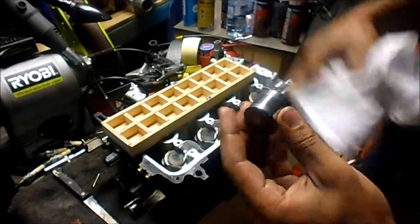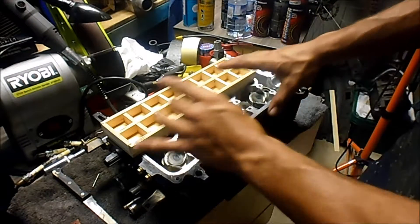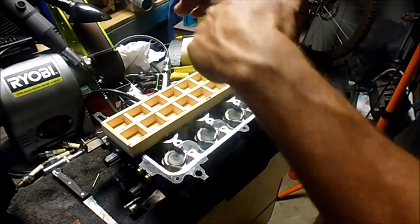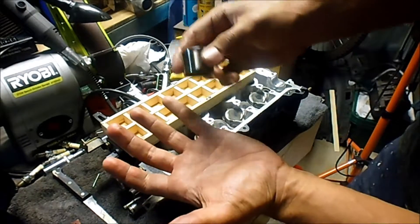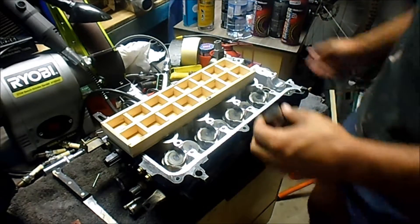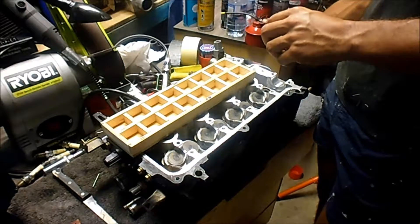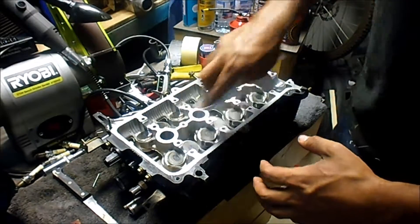Just give them a wipe over, inside and out, if there's anything in them before I put them in. I got the engine and blew out the cylinder where these go inside — the inside surface — just because I didn't want anything scratching that surface. So once it goes in there, it's all oiled up and nothing should be scratching. Now I'm going to wipe down these bearings.